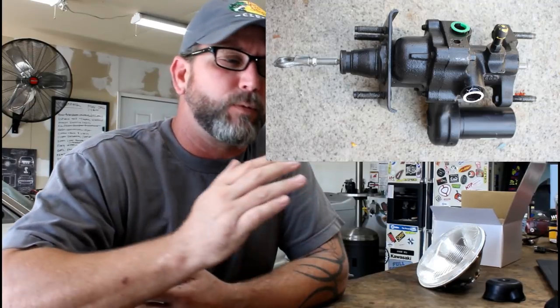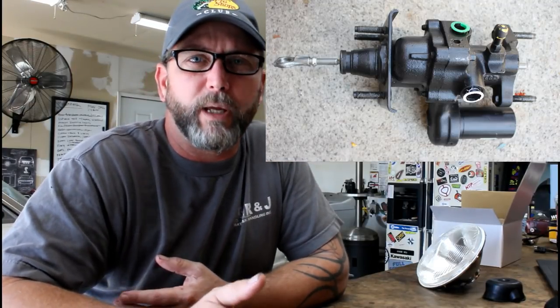Okay guys, well there you go. That's the Hydroboost brake install on Kevin's 94 Ford F350 OBS with the 460 gasser in it. The Hydroboost unit that Kevin was shipped was for a 96 and later OBS, the later model Power Stroke generation of F350. Although he researched and ordered the right part numbers, this is what he was shipped, so we had to roll with the punches and modify the bracket, since it didn't just bolt in as expected.